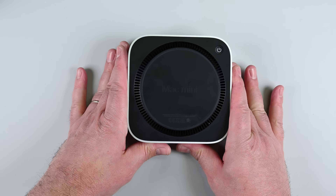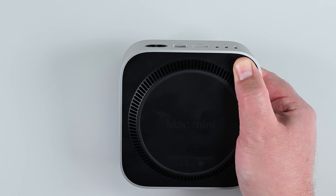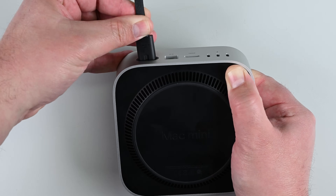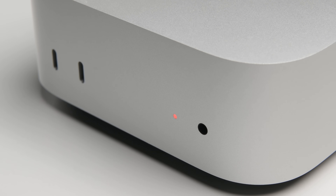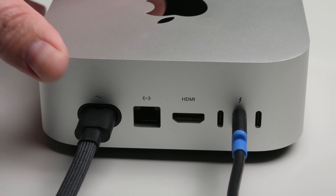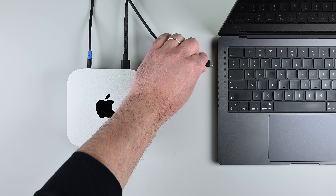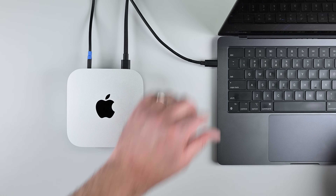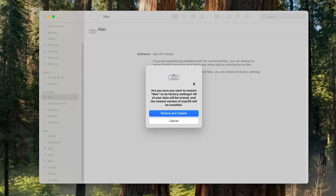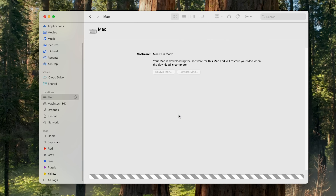Now we're ready to restore our new SSD for use. While holding the Mac Mini's power button down, plug in the power cord — this should put the Mac Mini into DFU mode. If you're successful, you should see a flashing amber light on the front of the Mini. Connect a cable to the central Thunderbolt port on the back of the Mini, labeled with a lightning bolt, then connect the other side to your second Mac. Once connected, the Mini should show up in your Finder window's sidebar. Simply select the Mini, click Restore, and let the machine run the restore process on your new drive. And that's it! You just saved yourself a ton of money and gave your Mac Mini a serious storage boost. Let us know in the comments how your repair went!